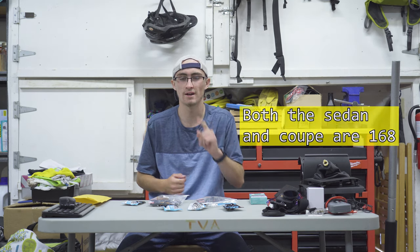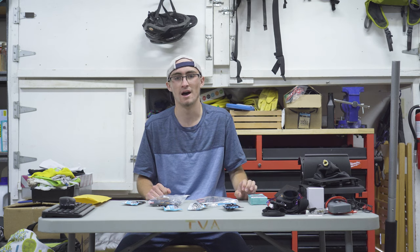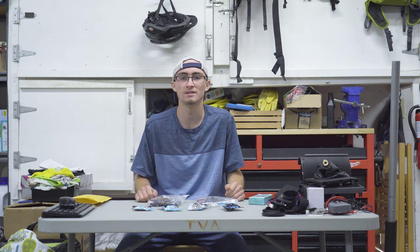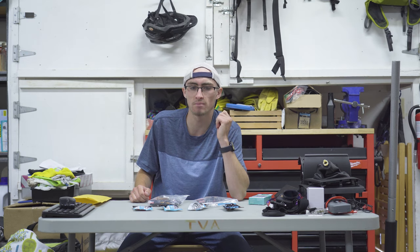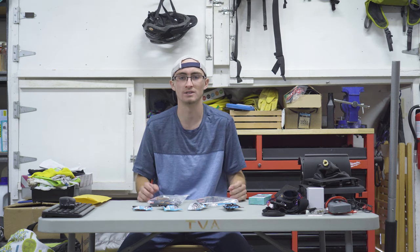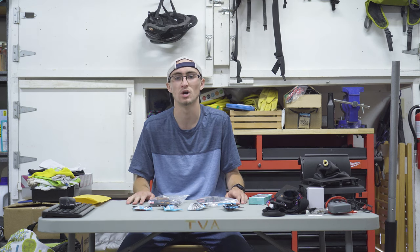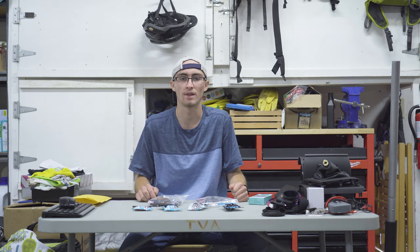For the non-brake or turn signal lights, we have these 168/194 bulbs — they're kind of interchangeable. These are 194 white Philips. Please note that the wattage they use is different, so if that's a concern, make sure you check before using one or the other, even though they fit in the same slot. We only have one white one here, and we're going to use that for the license plate light. On the sedan there's only one light; on the coupe there are two, so you'll need two. If you haven't seen episode three of this series, I went over the explanation of LEDs and the CANBUS system — be sure to watch that.